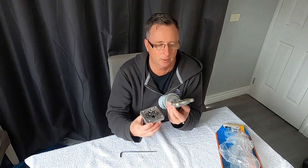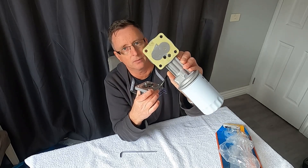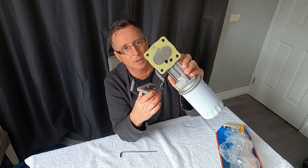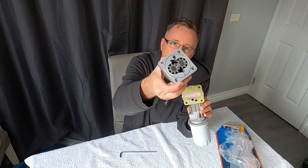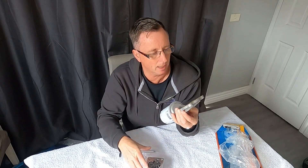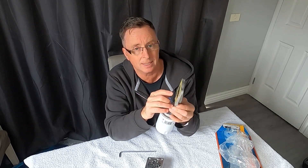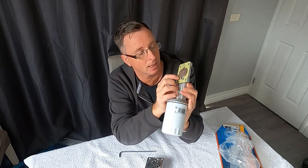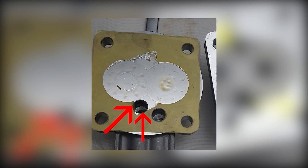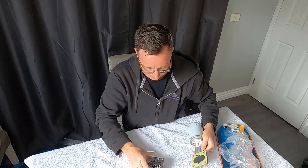There you have it. Obviously going off to where the oil filter is, the plate, and this is the actual pump itself. Just having a very quick look at the plate — I'll be able to show you up closer fairly soon. The gasket is actually overlapping one of the holes there in a couple of spots, so I'll trim that gasket up down the track and just make sure it's an all-good fit.